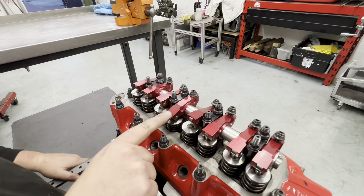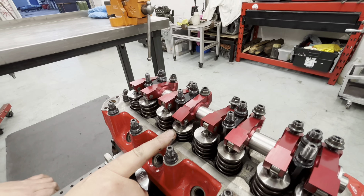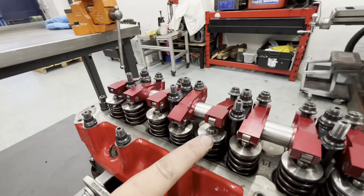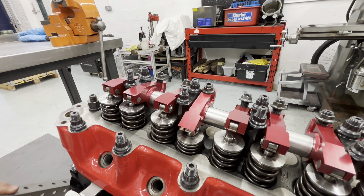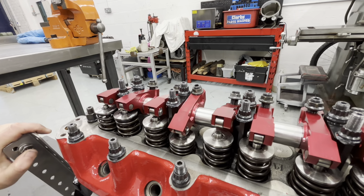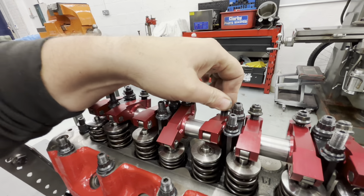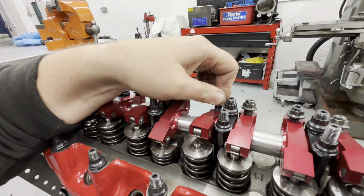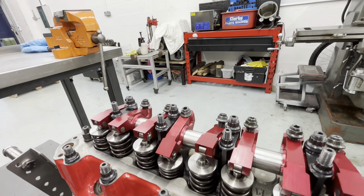So that's slack. I'm now going to turn it over so that we're getting full lift on this valve so I can do the tappet clearance on number four. So that is full lift. I now cannot move that roller rocker and I cannot rotate that spacer.